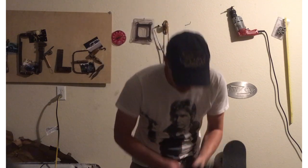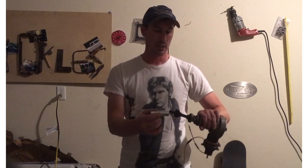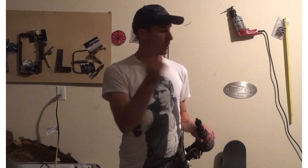For installing the gear, you need deep well sockets — they need to be pretty deep. I have some three-eighths drive deep wells and they did not work. So this is a half-inch drive. Just put it over and you can use a hammer. I was able to just tap it until I got it lined up. Once it lined up, that's when things got difficult, but I'll show you on this other distributor in a moment.